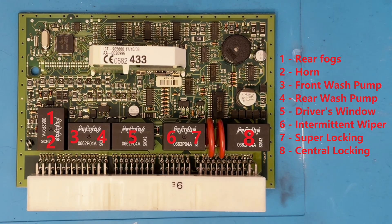Relay two drives the horn. Usually this is the cause of the horn not working, however it can also be the horn itself, as it was on my MG ZR, or the coiled clock spring behind the steering wheel which can also fail. I've also had one of these stick shut in the past. This is probably due to the horn being an inductive load.